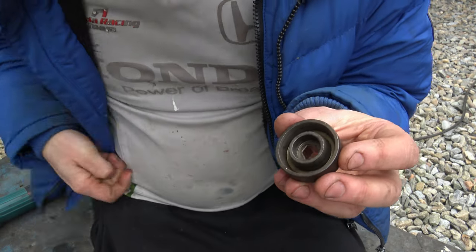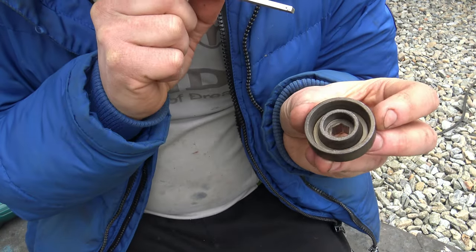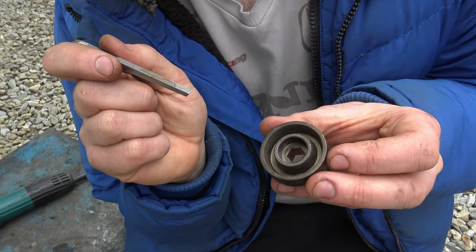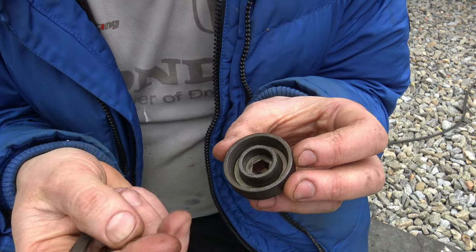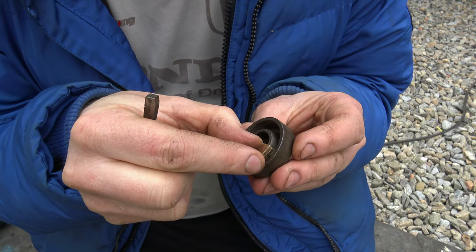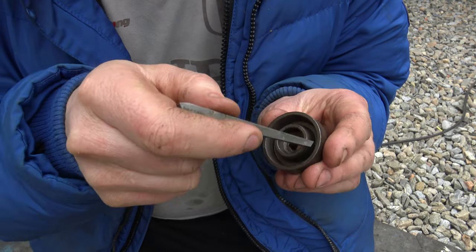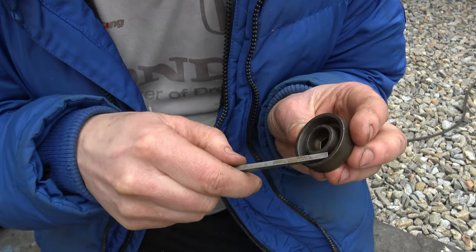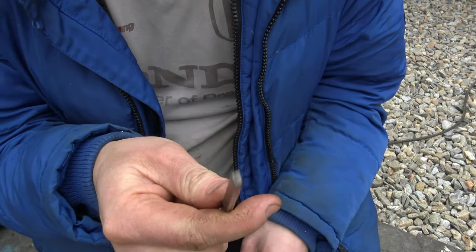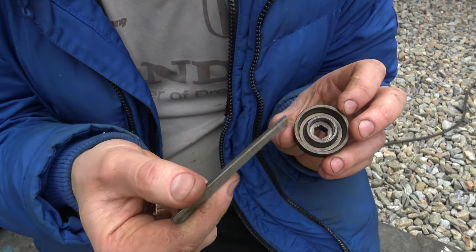As I mentioned, I'm going to cut a little bit - about half a mil - off the inside of this basket. Half a mil is quite a lot. I'll probably remove up to half a mil, just to see the clearance at the two faces. I'm also going to remove a little bit off this face and this face. So three faces in total - this one needs trimmed, this one needs trimmed, and then the inside here needs cut. We'll start working on this tool first and then put this into the lathe.